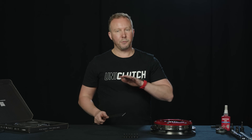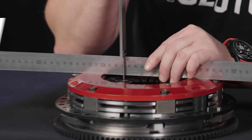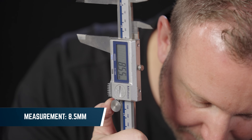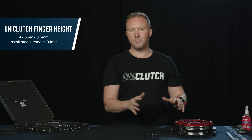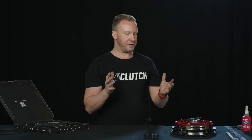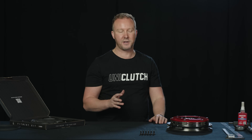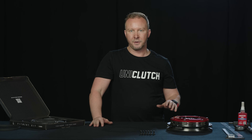We grab our ruler again and double-check that the finger height — that 34 to 35 millimeters we measured earlier — is exactly how we've got this set up. For people doing this on different cars or if your vehicle isn't in our catalog, you can do all these steps yourself and work out how to put a UniClutch in pretty much anything. The finger height is right in the window where it needs to be, so our factory release bearing will be sitting at exactly the right place, and the clutch will engage, disengage, and feel perfect — exactly like factory. Plus, you don't have to get your flywheel machined; the UniClutch is fully sealed and doesn't use the flywheel as a friction surface, saving hours of wait time and cost.